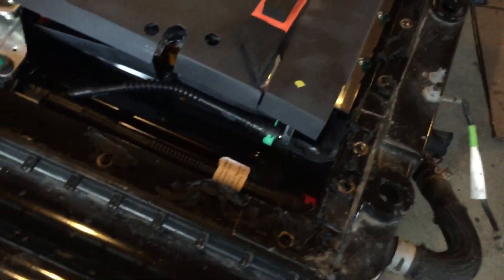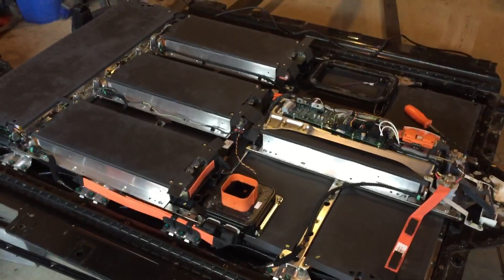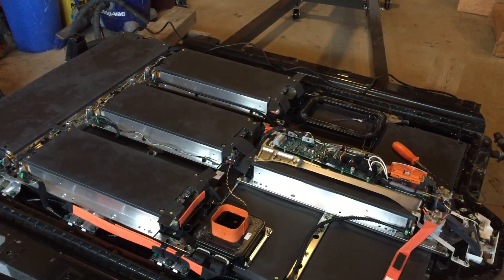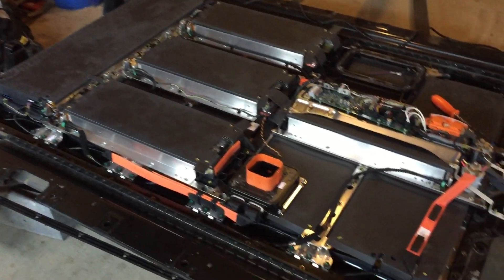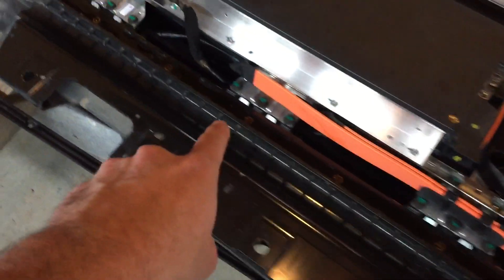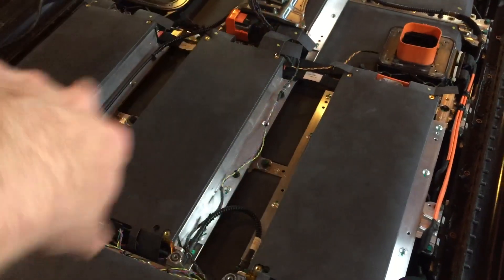Here's the main cooling system — the line that comes in. A lot of the Tesla packs go in parallel, but this one, as you may or may not know, has four smaller packs. I think those are five series blocks and then those are 12 series blocks. They come straight down the edge here and hit a bunch of these blocks, and they're pretty much all in parallel except for the two going to each of the smaller packs, so they're in series-parallel.